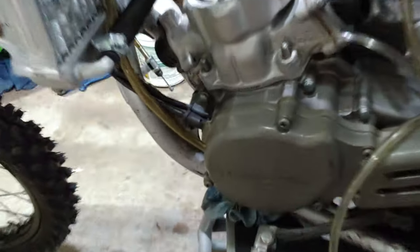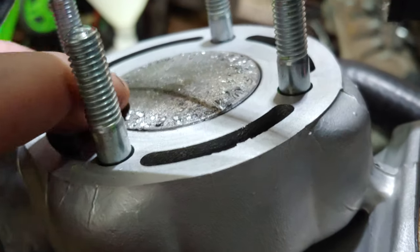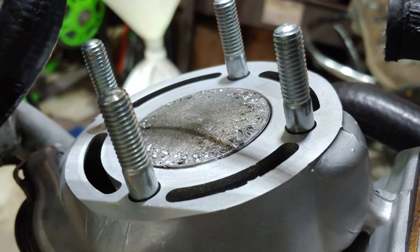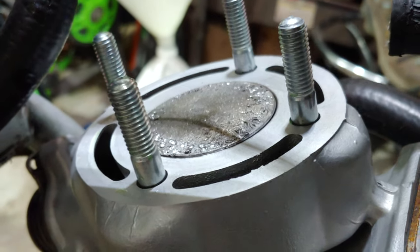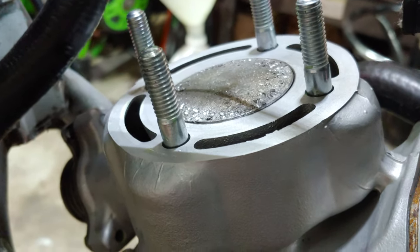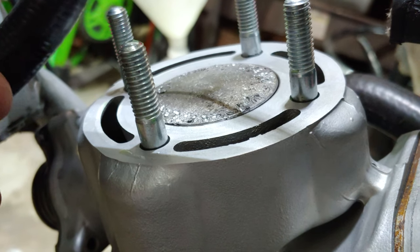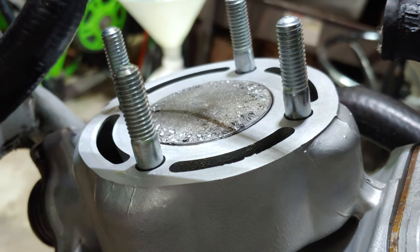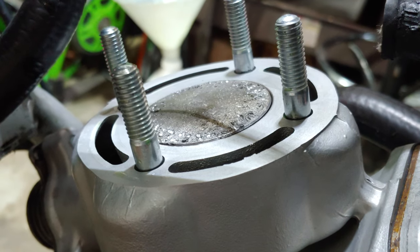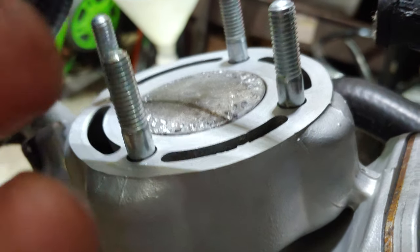So I kind of questioned this to begin with - this is another one of those Vertex pistons, and this is almost identical to what happened to the last one. When I took the thing apart and put it back together, Luke at Luke's Racing told me to keep an eye out for any play in the connecting rod. Well, you could barely hear and barely feel - and I'm talking barely feel - any type of up and down play in the crank and connecting rod.